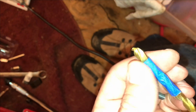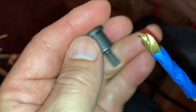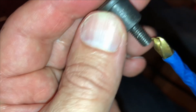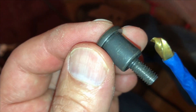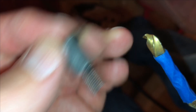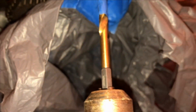I've got the quarter-inch drill bit that I need to bore out the stripped hole. What I do is put a piece of masking tape on the bit at the approximate depth I need to drill — this screw is what needs to go back into the block, so I don't need to go in any further than that. I drilled in and stopped when I hit the tape, so that should be a deep enough hole with the quarter-inch bit.